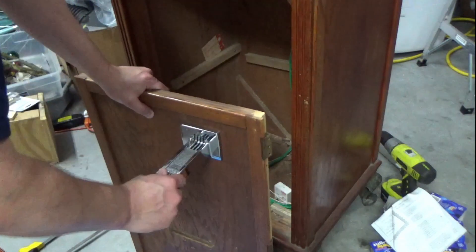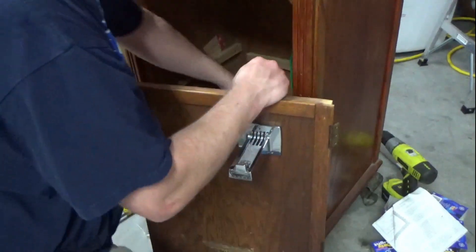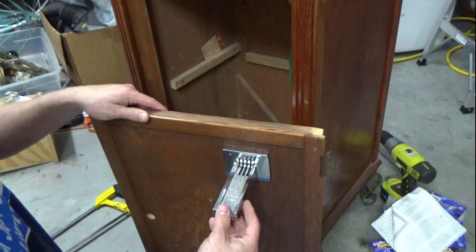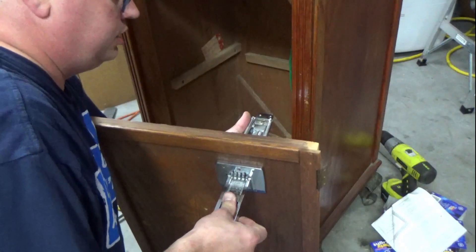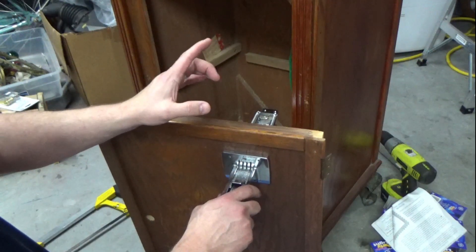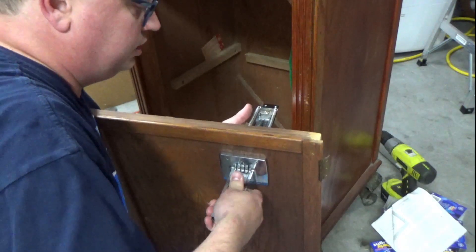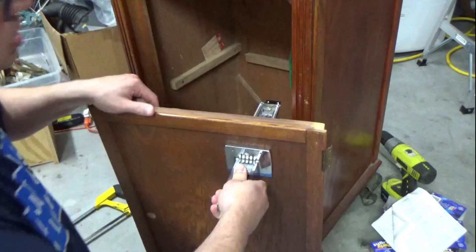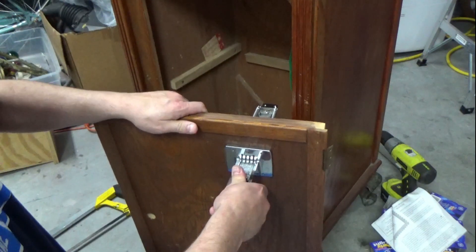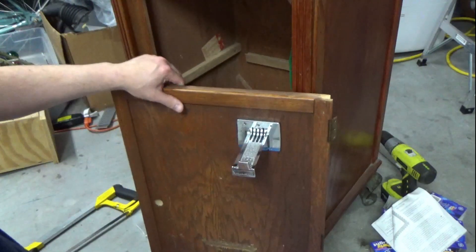I'll grab a quarter. Slot number one — locks. This time I'm going to try to catch the quarter. Quarter in — you should hear the ratchet. Yep, there's the ratchet, which you saw on the repair video. That long L-looking thing with the square holes — that's the ratchet lock. So once you start to vend the coin you can't get it back — you've got to push it all the way through. Which works correctly — as soon as you hear it clicking. That door is good to go as far as the coin-op.